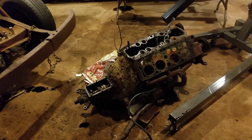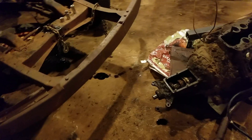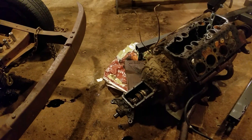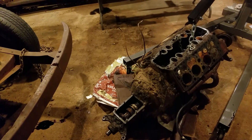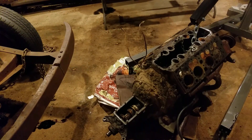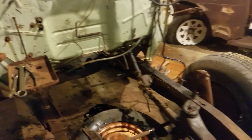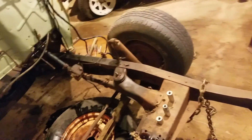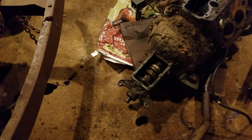There is the motor — we've got it out. The driveshaft came off pretty easily, surprisingly. The bolts that held it to the frame were a little more of a challenge. There's only four of them, and only one of the nuts came off easily; it's only held together with castle nuts and some pins. The clutch shaft is only held on by a pin. We disconnected everything and took the gear shift off so we could get it out. The transmission actually looks incredibly well — pretty good, just dirty, a lot of oil and a lot of dirt.